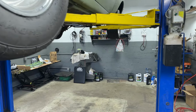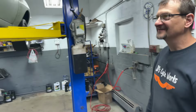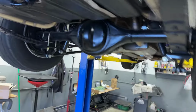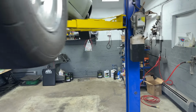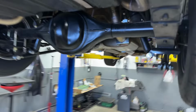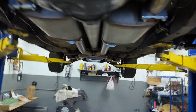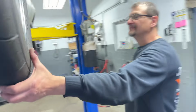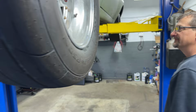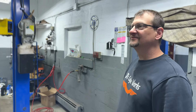Well, the second gear roll on it had plenty of traction. It did. So that worked just fine. Just in the dead stop, it's not working very well. That can be adjusted with the preload on this link here. That'll put more weight on a different tire to help it go straighter. I just have to go out there and experiment with it and adjust that link, and that'll straighten it right out. I can see there's less weight on here from the rubber mark, so I've got to change that to put more weight in that tire, which I can do.